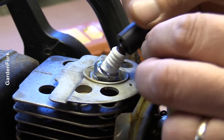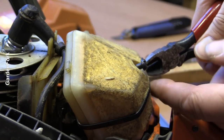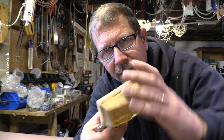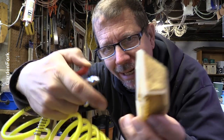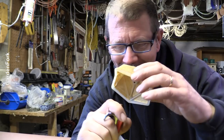Don't forget to reconnect the wire. The air filter is in pretty good shape, but you can clean this off with a brush. Take it outside and do that. If you have an air compressor, you can blow this out — blow from the inside out. Do it outside and don't spray it toward yourself, that would be a bad thing.